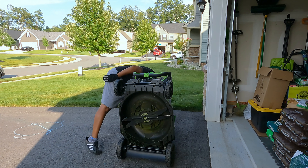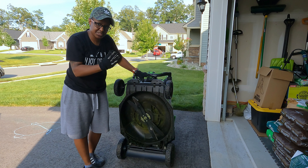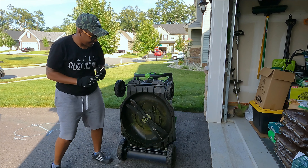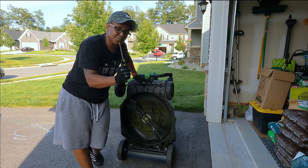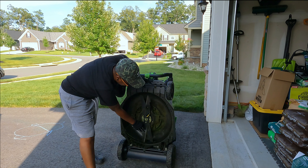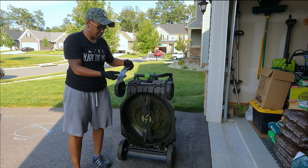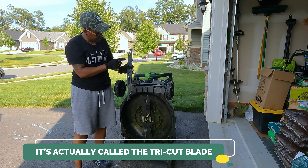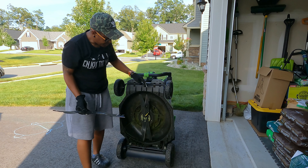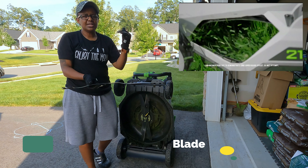Let's talk about the dual blade feature. I just made sure to take the battery out first — never mess around with these blades without gloves on. Ego makes blade changes pretty safe and easy: you stick a screwdriver in there so when you go to take the blades off it catches and you can safely remove them. There's also an interchangeable mulching blade — you can see the grooves in it that set it apart from the regular blade, which has just one groove. The mulching blade is better for the fall; in the summer I use the regular blade, but in the fall I'll switch to the mulching blade because it grinds the grass up into smaller pieces.